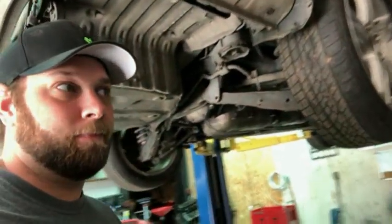So, we've already been under the car once, and this ain't like the G35. Every bolt to hold the diff in is an Allen head. So not your normal hex head bolts. Bit of a pain to deal with. So we're literally going to put the car up in the air, put the e-brake up, break some loose, lay it back down, let the e-brake loose, rotate, and do that. Probably got to go buy some tools too because I don't have the right Allen to fit the bolts to hold the back of the diff. So now, back at it.